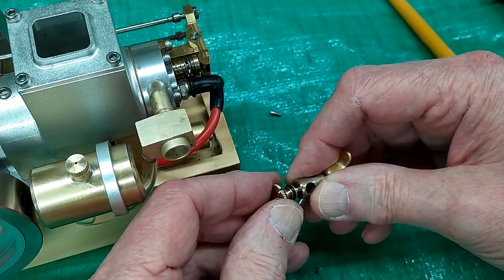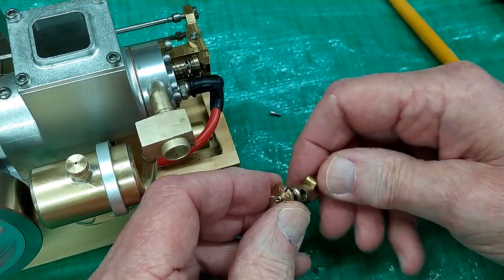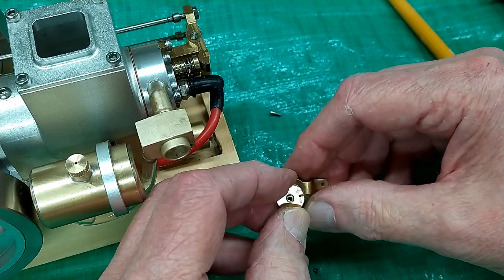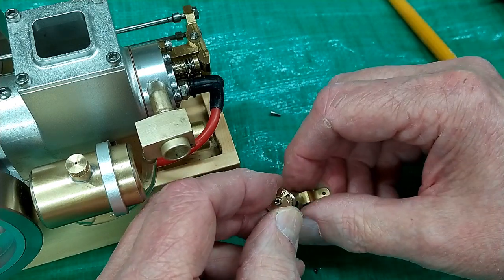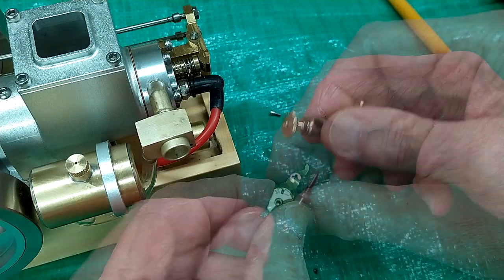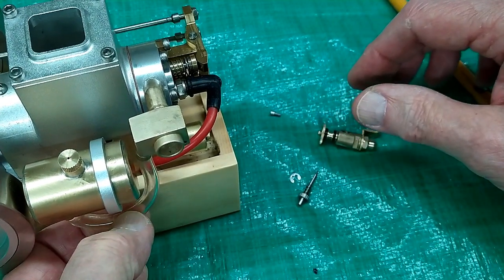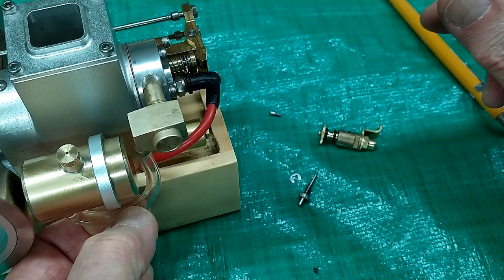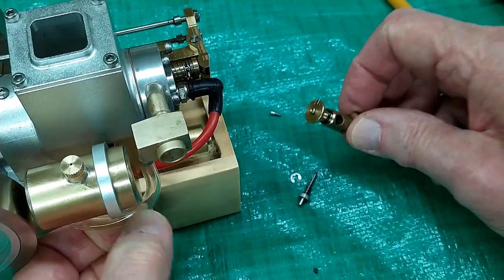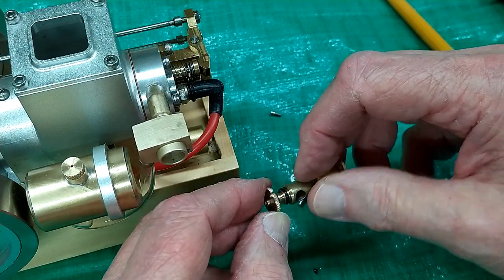One of the problems here is this is a very tight fit — I think it should be loose, but it's tight. When the barrel moves back and forth, it's wiggling this disc, and it will eventually work its way towards the plus, which gives it more fuel. So when this was running so rich I couldn't get it to rev up, I pinched the fuel tubing, which starved the fuel, and the thing would rev up. That convinced me this had to be some sort of metering mechanism.